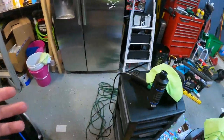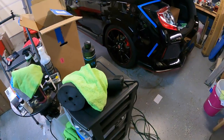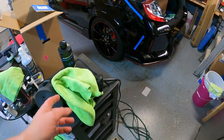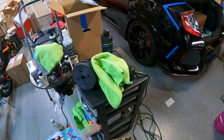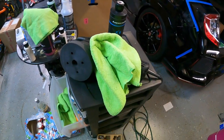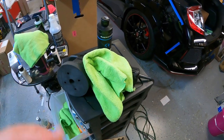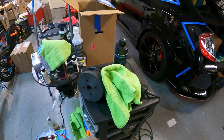Water spots are essentially a mineral deposit, and I'm getting them off with this pad — which means, if you think about it, where is that going? Some of it is getting wiped off in the leftover residue, but some of it's going to be embedded in the pad. So do I want to use this pad to do the whole car? Probably not. I better at least clean it — but I just have a little pancake air compressor. So I'm going to change pads before I move on, because I don't want to use a pad that could potentially have minerals, calcium in it, to buff the rest of the car. I feel like that's a recipe for disaster.